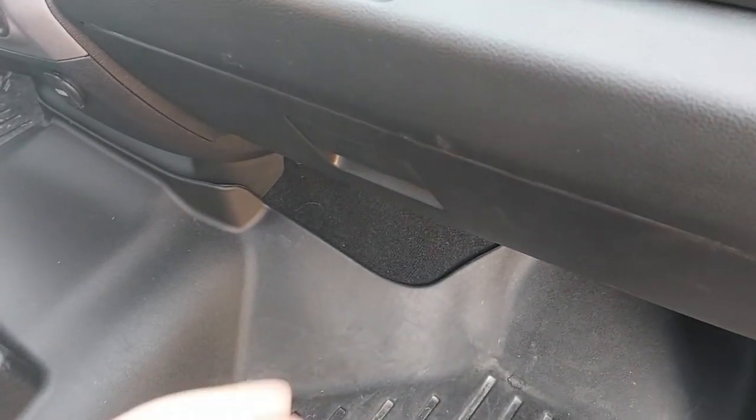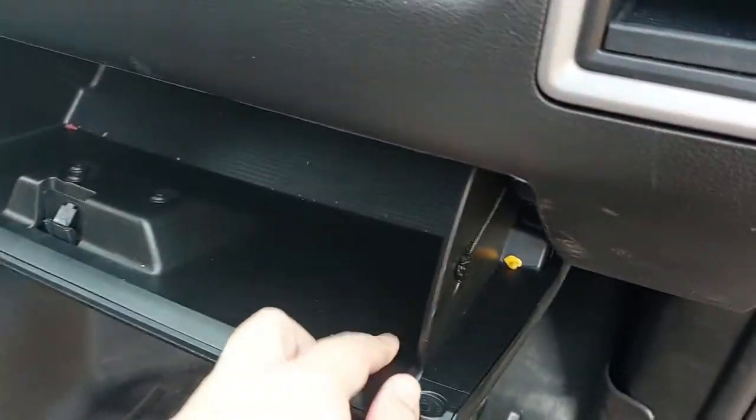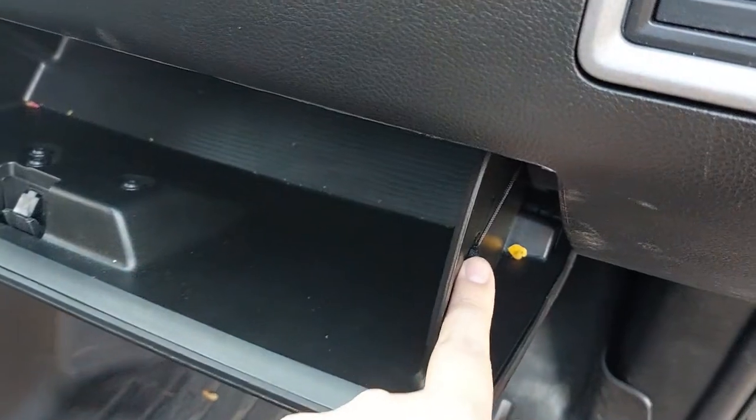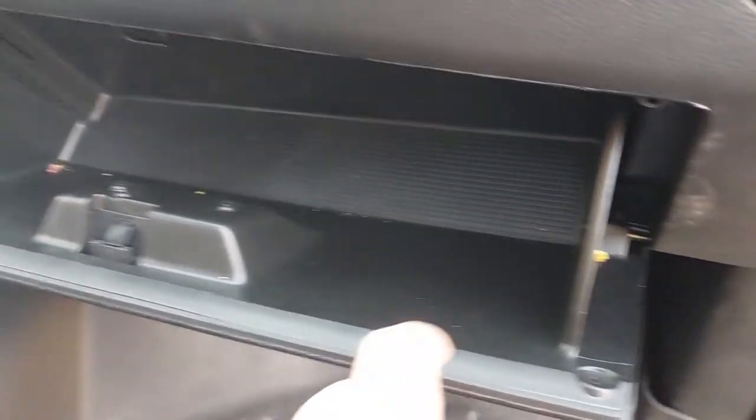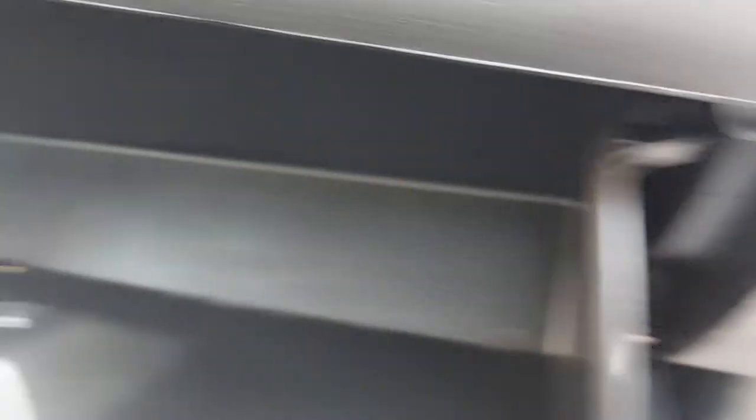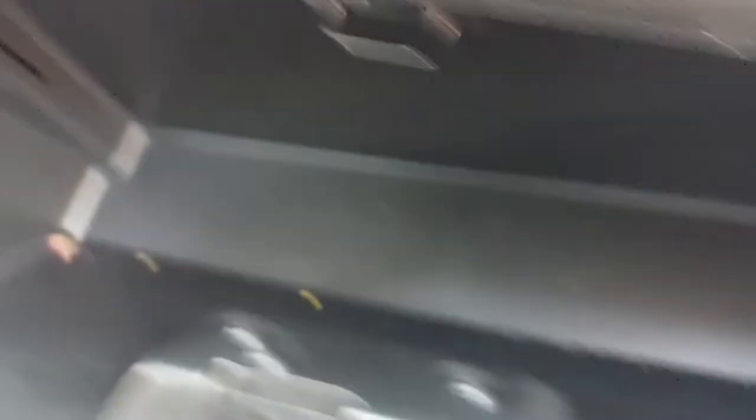So to do this is really easy. All you do is go in your glove box here, open it up. I've seen videos where you remove the cable here, but I actually found that it's not necessary. There is a little tab up here and another one on the other side. This side is actually easier — it's already popped out. This side you do have to force it a little bit more, but you are going to pop both out. Then with the glove box you're going to push up so it removes all the tabs on the bottom, and then this will just hang here because it's still connected with the cable.